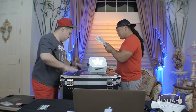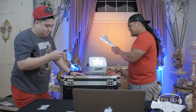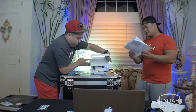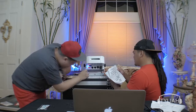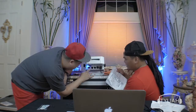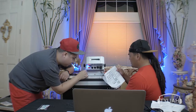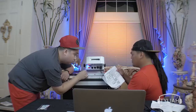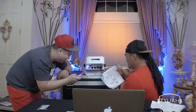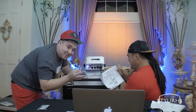Where does it start? Press the menu key. Digital display. I don't understand what that means. Address. Okay, I think they're talking about the back of this. So this needs to show address. Press the enter key for 2 seconds. The digital display will show RFRT. There, perfect. RFRT flashes, then use the remote control to the machine's infrared receiver head to press any remote control key.